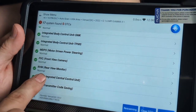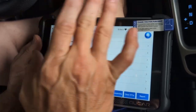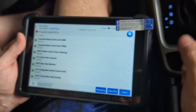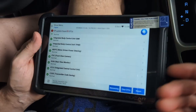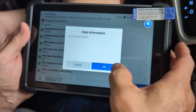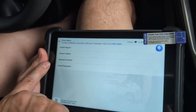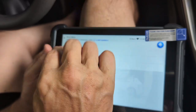There is a camera on this car on the rear, and it checked that too. If you did find something and fixed it, you just clear your DTCs, hit that, and clear out the code. Run the scan again — if it comes up again you didn't fix it; if it goes away, it's resolved. You can also make a report or rescan. If you want to select a specific system to scan rather than all of them, you can do that here.